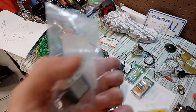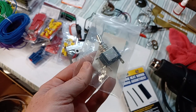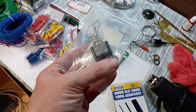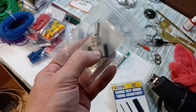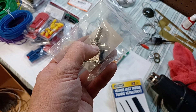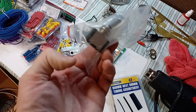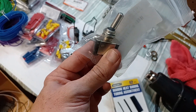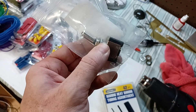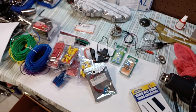Here's another switch — when I bought this it was a two-pack. This is the high beam toggle. You can see there's ground on the left and then battery and high beam. When you're buying these, make sure it's the metal housing, threads, metal nuts, and washers. I've made the mistake of buying some that looked good but ended up being plastic, and that might work for a dashboard on a truck, but on a rattling and vibrating Harley you want good metal stuff.